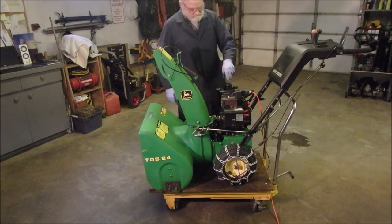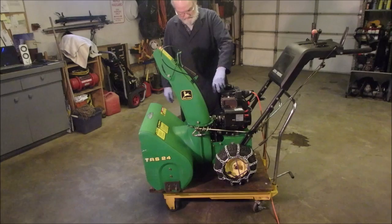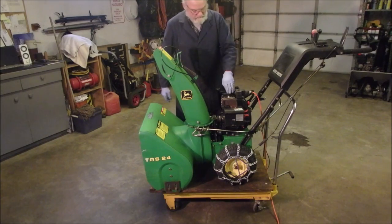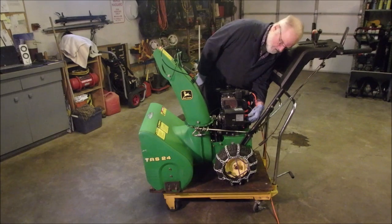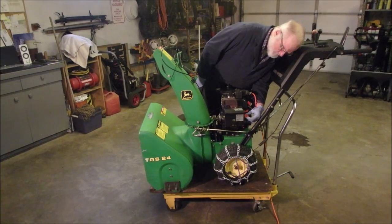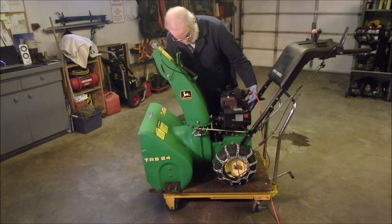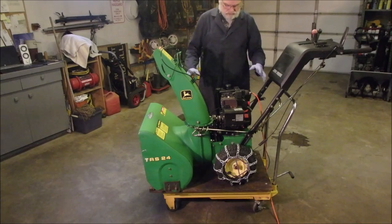Fuel! Okay. Check for oil. Might have lost it. Nope, it's good. Spark, ding, turn on. Choke. On, off. Two or three pumps. This should do it. This should just go.